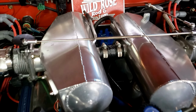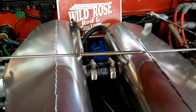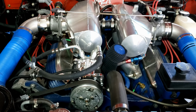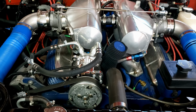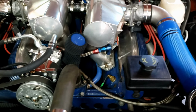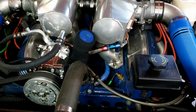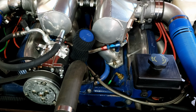The distributor back there, you can see that blue thing way in the back, no leads into it, of course, but it is the cam timing sensor. So we get my cam timing from there for the computer. I made the adapter bits inside of that too. And the heads are pretty gnarly. A friend who builds race engines did those heads for me. The original Cadillac has pretty small valves, and he couldn't go very big with them. We could go from 187, 150s up to 194, 160s, which was a Chevy size.